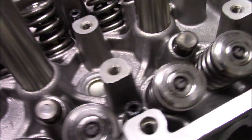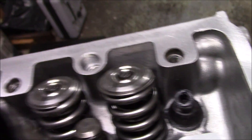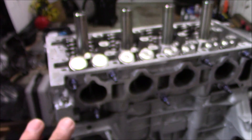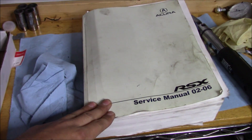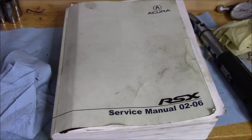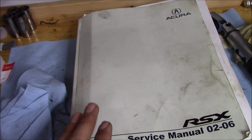We're going to torque the head down to 70 foot-pounds in three steps: first 25 ft-lbs, then 50 ft-lbs, then 70 ft-lbs final torque. All the nuts are run down snug with the wrench, torque lube applied. I want to touch on the book I used for all my specs — it's the actual RSX OEM service manual, for 2002 to 2006 Type-S and base model. You can find it on eBay. It gives you everything from troubleshooting to specs. I'll try to find a link for the description.